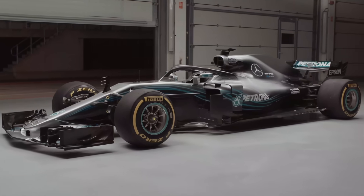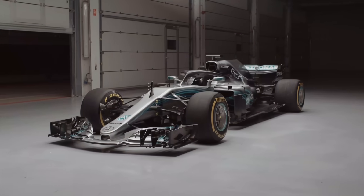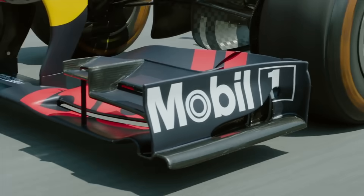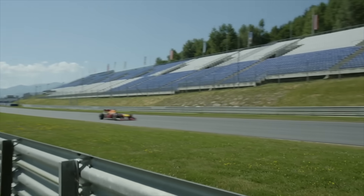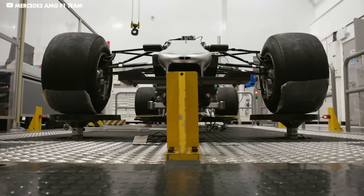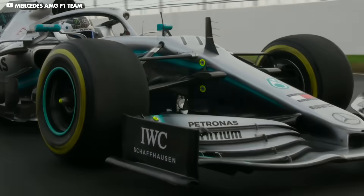There are a few interesting concepts at play here. One reason is that the aero platform of an F1 car is far more stable without suspension, giving the driver more consistent downforce across all four corners of the car. When a car is braking, cornering or accelerating, it undergoes weight transfer which causes pitch, roll and heave. Even a modern F1 car suffers from a certain amount of this, and it can affect the aerodynamics of the car significantly.